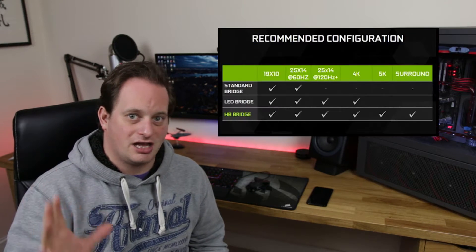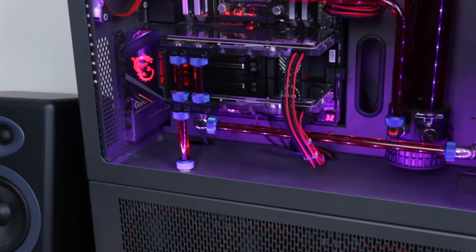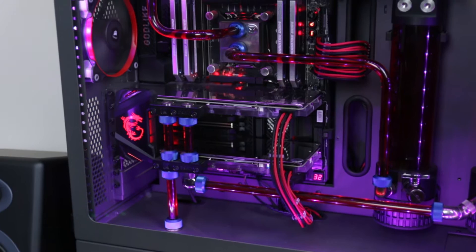When the current 10 series of the GTX line of Nvidia graphics cards was released, along with it came the release of the new high bandwidth SLI bridge, and also came the demise of three-way and four-way SLI configurations — probably not a bad thing. The point of diminishing returns was easily achievable with three cards, and four-way SLI was effectively a complete waste of time. Nvidia has taken two of the fingers of the SLI connectors and created a new high bandwidth bridge that connects to another set of two fingers on another card, effectively increasing the bandwidth.